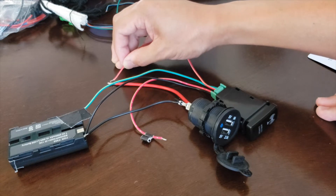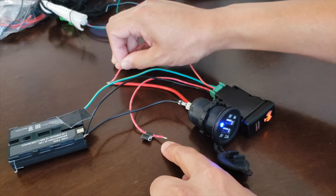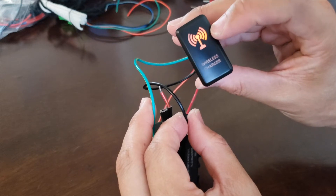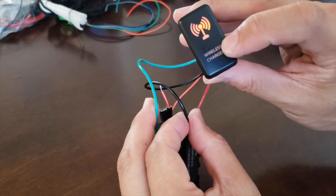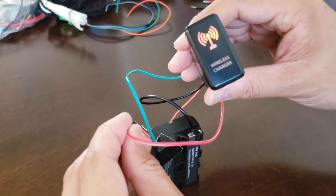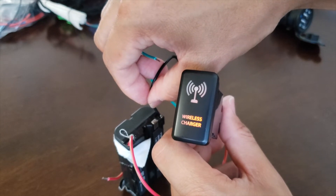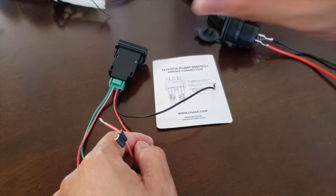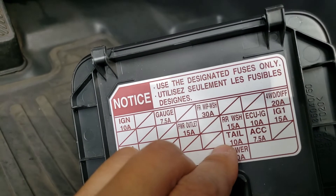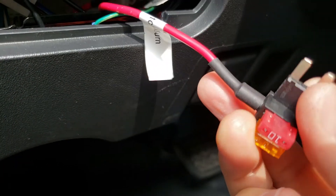That's essentially what you need to do on a very simplified scale. Now that leaves us with the Red 2 line, which is meant for the light on the switch. There are actually two bulbs in these switches — one on the top and one on the bottom. The top one lights up when you activate the switch, and the bottom one is controlled by Red 2. If I connect Red 2 to my positive terminal, you'll see that it lights up. The bottom bulb is meant to be illuminated whenever you turn on your headlights — typically this gets connected to your taillight fuse or instrument cluster fuse, so when you turn on the headlamps it illuminates this bulb. I've been using the taillight fuse, and so I have connected Red 2 to an add-a-circuit, which then gets plugged into that specific fuse.